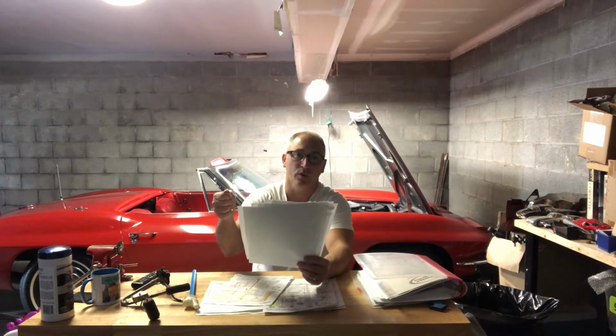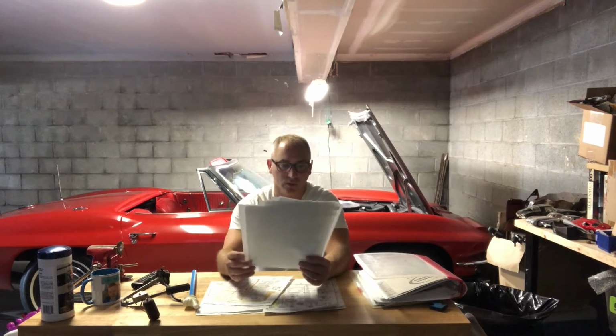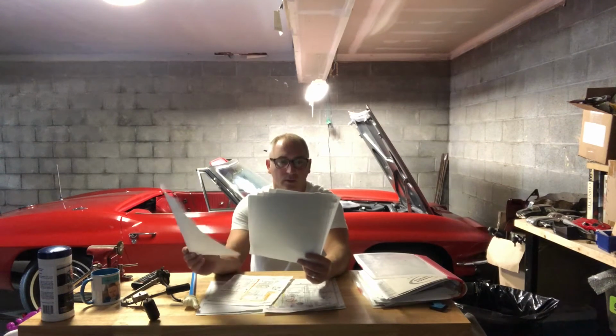If you didn't know, you would find out quickly that they're not easy. The connections aren't easy to get off, as well as the access to it from underneath and behind is not easy. And there's a cool trick with getting longer bolts to pull out the dash or the cluster while it's still connected, but you still have to be a contortionist to get underneath it. Definitely pulling out that driver's seat is the right thing to do. Just a hint there.